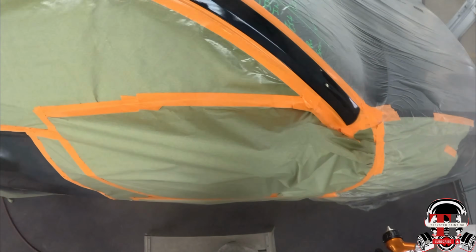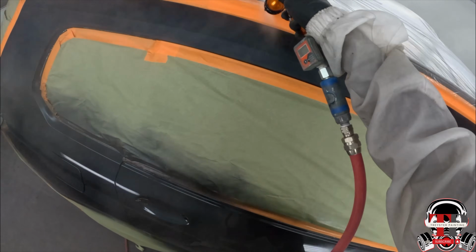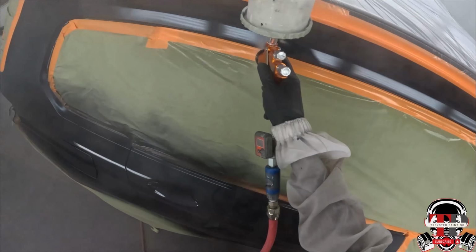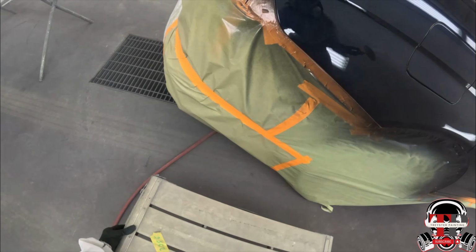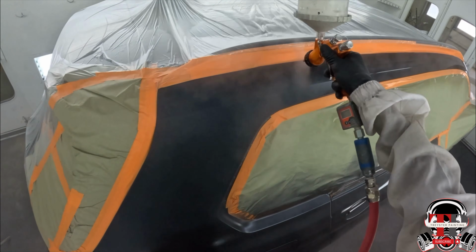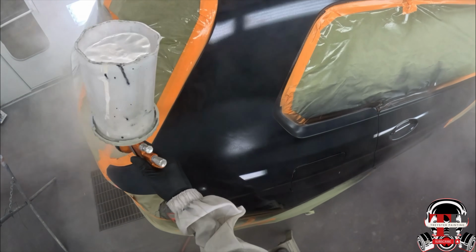We go by what we think lays the clear down, what works for the clear, because you have different clears. You got some that's thicker than the other, some thinner than the other. So with a thicker clear, you'll have to bump up your psi even more. So it all varies on how the clear coat is.